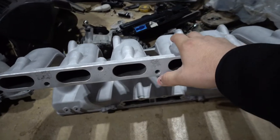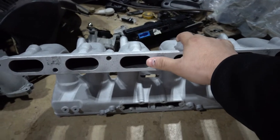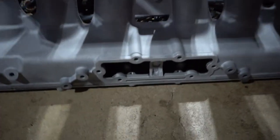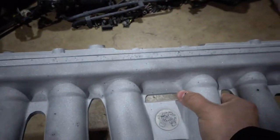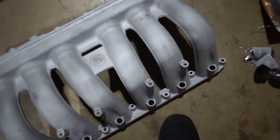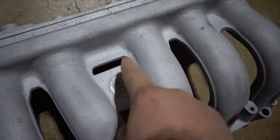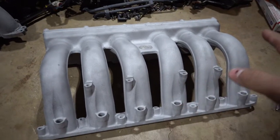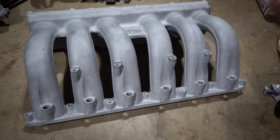New day — let's jump right into it. First order of business, I want to hit the bottom of this with the wire wheel so it can be nice bare metal down there as well. Basically every spot where the gaskets will be — right here where the throttle body goes, and right there too. I also want to go over it with the wire wheel on the badge just so it can be nice and shiny. After that we'll wipe it down, throw it in the oven, get all the contaminants out, and then we'll be ready for powder.